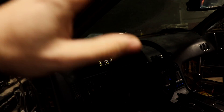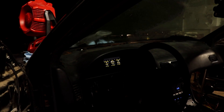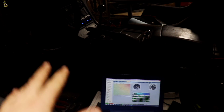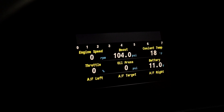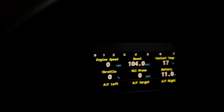What is going on guys? I have some amazing news. Right there is my AEM CD5 dash and if you've seen the videos I've done on that and the past couple videos, we have had an issue getting it set up because we kept getting CAN bus errors on our ECU. After some messing around, it actually says stuff. Although one thing that is kind of weird is that with the car off, we are reading 104 psi of boost — that's not right.